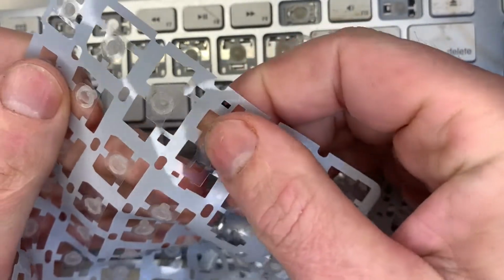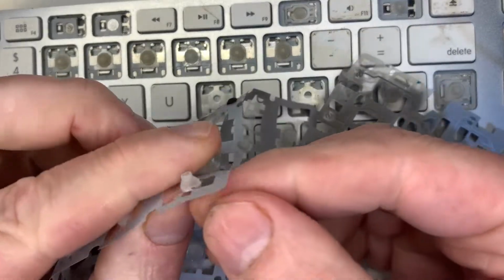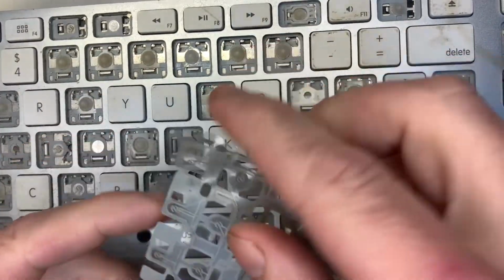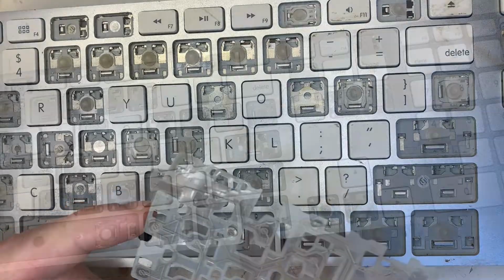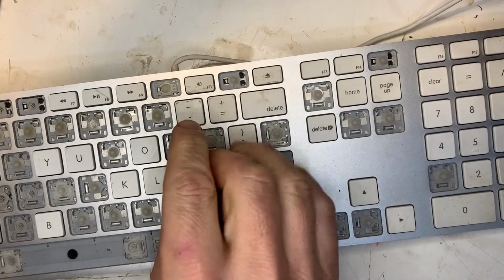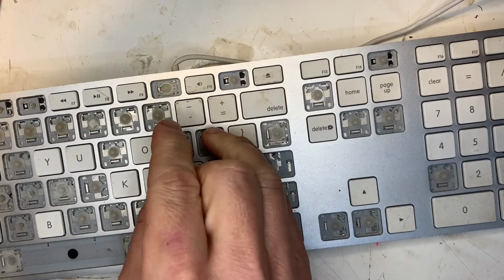The button layer has no tracks, and unlike a television remote or game controller, it isn't electrically conductive. It's a straight silicone cup that deforms and gently pokes the conductive layers in just the right spot when a key is pressed. These can get damaged due to a manufacturing defect, poor handling, such as improperly storing your keyboard, or an accident while cleaning it.